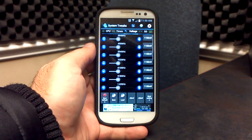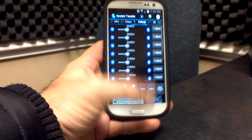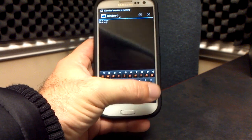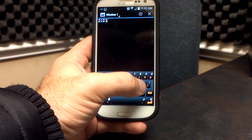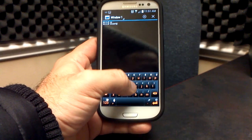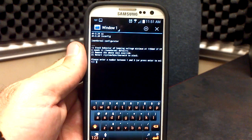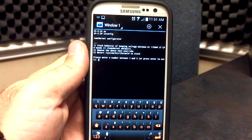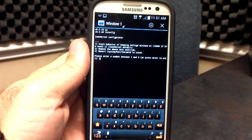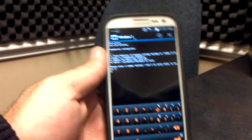If you are stuck at 1,150 — like how you see right here — your voltages are at 1,150 and they won't stick, this is what you need to do. You need to go into Terminal Emulator, type SU, hit enter to get superuser access. Then type in LK config and hit enter. You're going to have some options here: stock behavior of keeping voltage minimum at 1,150; number two is remove the above override; and number three, revert system to stock. I'm going to go with number two to get rid of the override. Hit enter, and you're done.